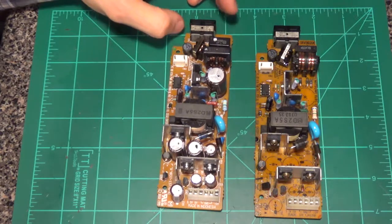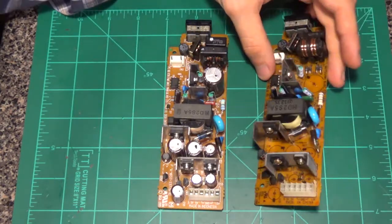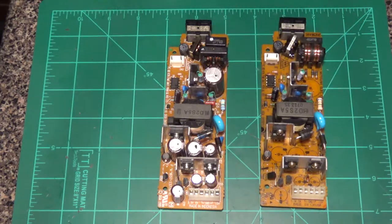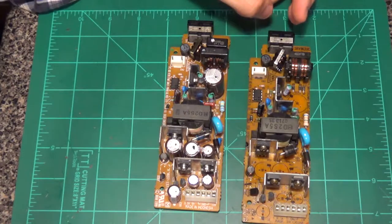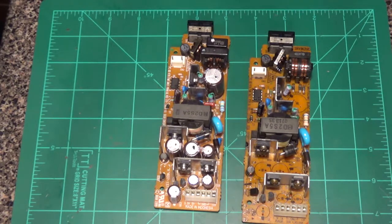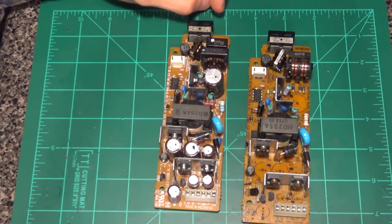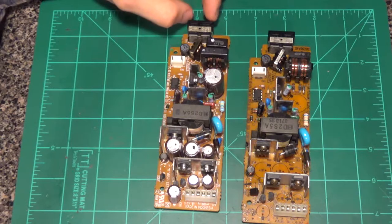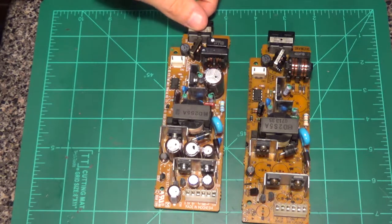The reason is I've noticed a lot of issues with these power supplies. I think the capacitors just dry out on them. I'm not sure why they dry out so quickly — maybe just from age — but I've recently discovered that bad power supplies have caused one of my lasers on one of my Dreamcasts to not even turn on.